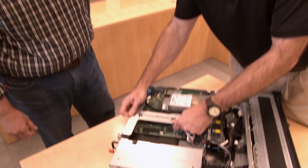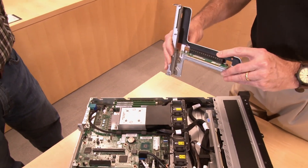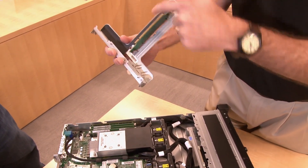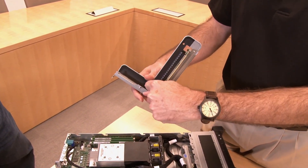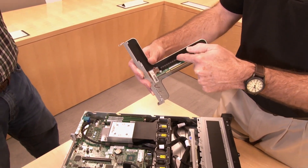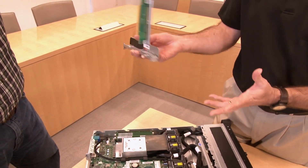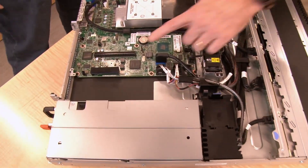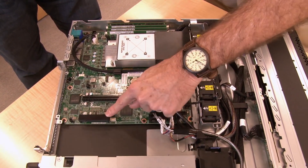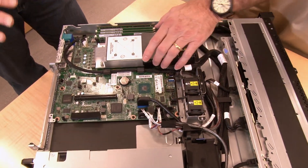The Butterfly riser card has two variations. This one has a single PCIe x16 slot, but the other variation has two x8 slots — one full-height half-length and one slimline. On that second variation, the connector will be physically x16 but electrically x8 on both sides. The connector for the internal RAID card is physically x8 but electrically x4, which in a system like this really shouldn't matter.